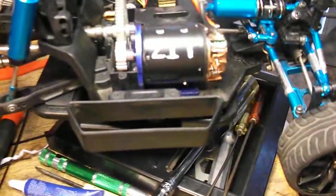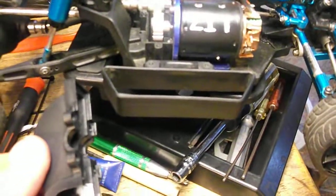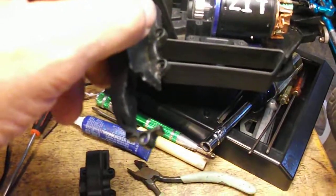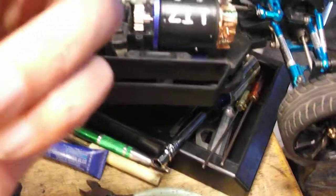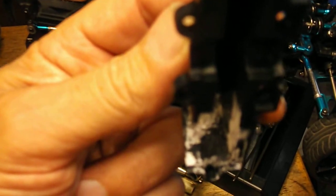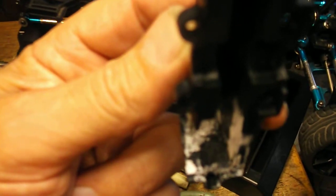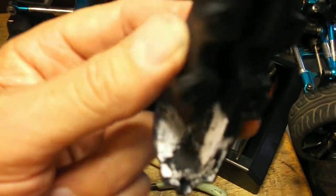So when I put this cover on and turned it over, I heard some horrible grinding, and I went, oh crap. So I put my other cover on, the one not on, and the grinding's gone away. Okay, the problem's here in the pinion, it's touching somewhere. So then I put whiteout all over the inside, and you can see, well, now I can't point to it, but on the inside where it's not whiteout, it's black to the inner right, middle to the right. You could see the pinion was rubbing that, so I took my Dremel and opened that area up, and now it's clearanced. So I can now run the full cover.